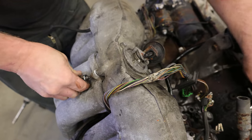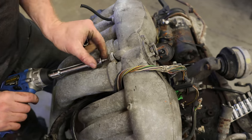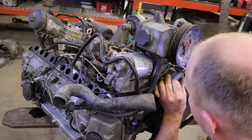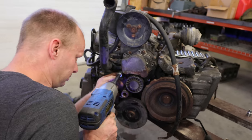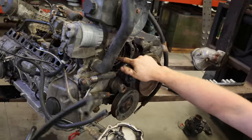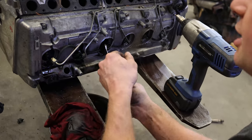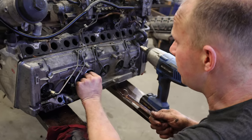It's got a vacuum-actuated flapper inside, maybe for heat. I've seen that on old gas jobs but never on a diesel port. So this fuel pump is on a wave ring, and it just hits this roller and then pumps back and forth — that's pretty interesting. Generally in our climate, we're not too thrilled with plastic lines and rubber lines because that is always an opportunity for it to leak. I'm giving my opinions while I'm taking the engine apart.